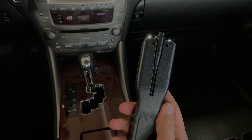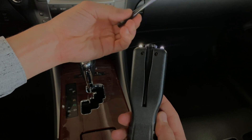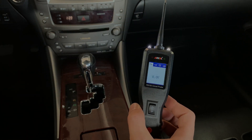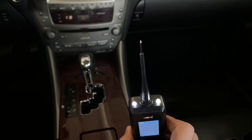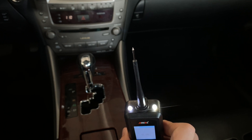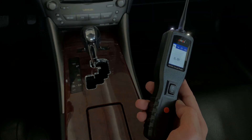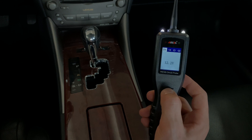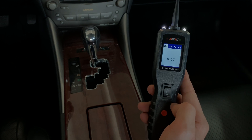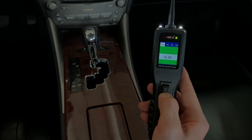In the back of the tool we're going to find a removable probe tip. All you've got to do is take it out, insert it into the hole on top, and the tool is ready to go — very quick and easy setup. The top of the probe tip is sharp and pointy to allow you to reach into electrical connectors or poke through wire insulation. What really makes this tool stand out compared to a regular multimeter is the ability to send positive or negative current to the tip of the probe. This feature is going to be very helpful when troubleshooting issues with electrical circuits.